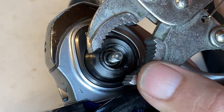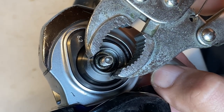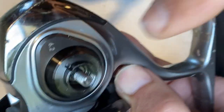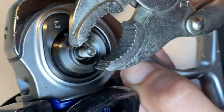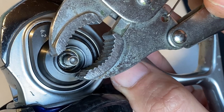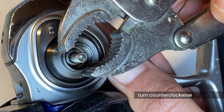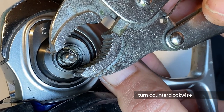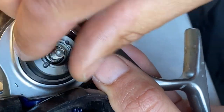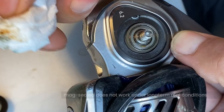So I tried it with this plier — and you will see it works. The corners of the plier you should set directly into the holes, into the guides of the holes. You have to adjust the plier and then press it firmly in the direction you would open a bottle — counter-clockwise, to the left. Then you have the gearbox opened.